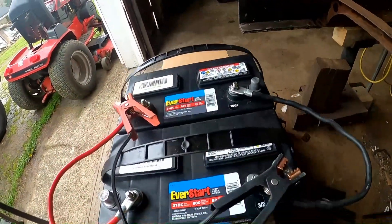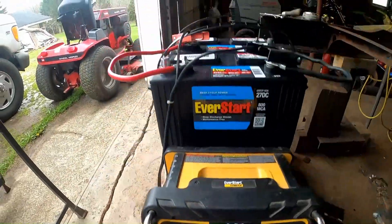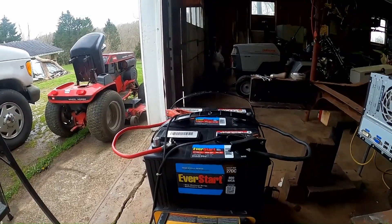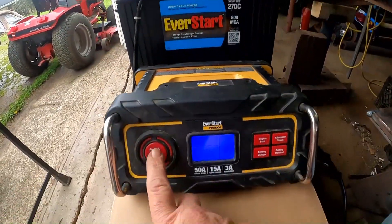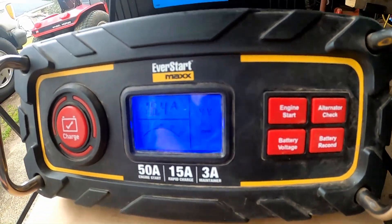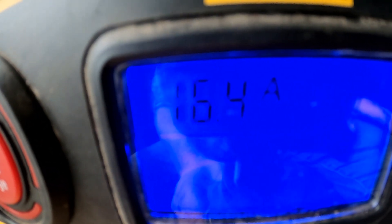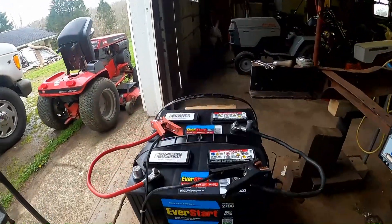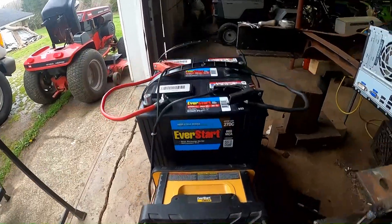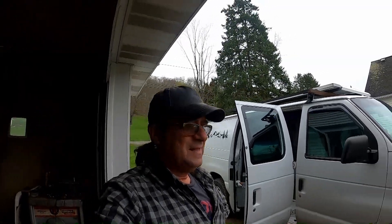So I'm going to put it on charge. They've been sitting on a shelf since they were manufactured, probably went to a warehouse, sitting a while. We'll just top them off - they're in a healthy range but we'll fully charge them. Initially it's going to charge at 16.4 amps and that'll start settling down as the charger evaluates the batteries. We're going to absolutely top these off so they'll be at their best, fully equalized since they're now married together.